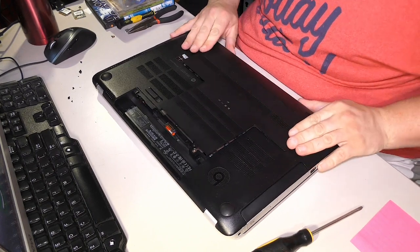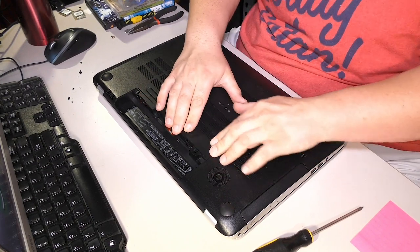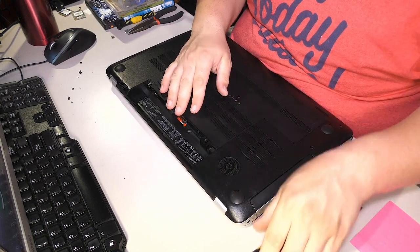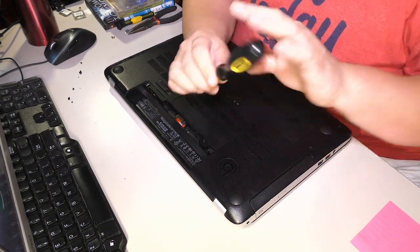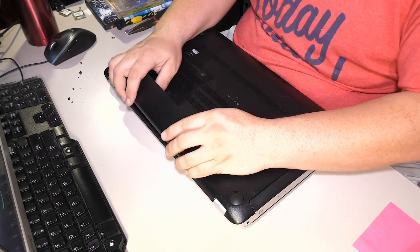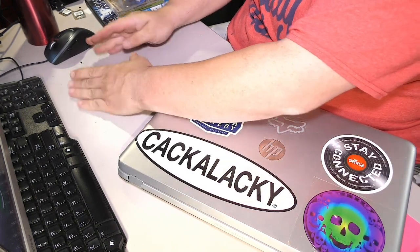Alright. Get this plate snapped back down. Okay. Make sure all the clips are down. Put this back here. Now, with any of these epoxy resins, any of these plastic welding liquids, they usually take a day to cure. They harden fairly quickly, but they can take a long time to cure, and they're not full strength until they do.